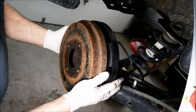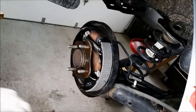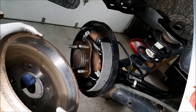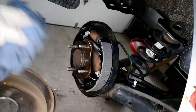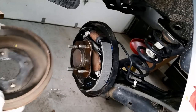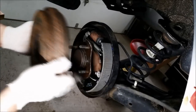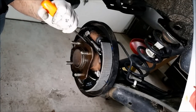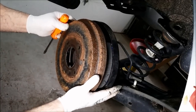I am reusing the old drums — there's really nothing wrong with them. They're not worn or heat-checked or anything like that. They actually stopped pretty good — I did road test it beforehand. See if we can save a family member a couple of dollars. These are the original Nissan drums, which are a whole lot better than most of the aftermarkets. We'll slide that on there and adjust this as much as we can, then finish it up through the adjustment hole.